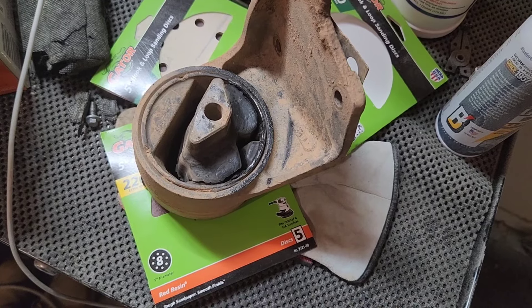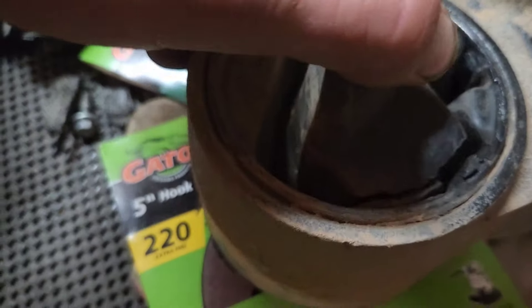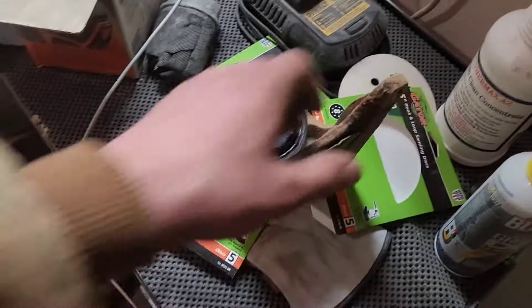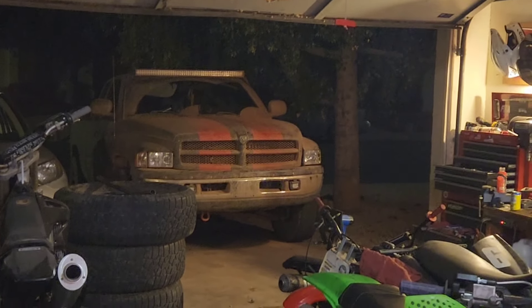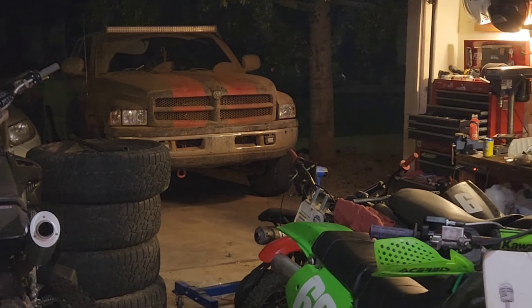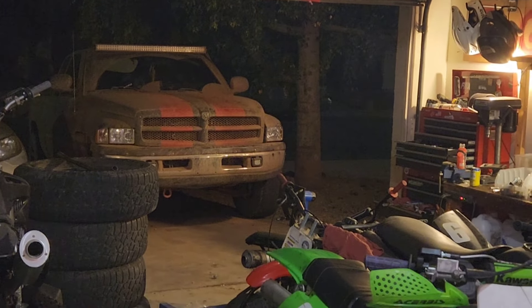Once I got everything positioned in, I went ahead and tightened everything down about as tight as I could get it. Both engine mounts were pretty done to say the least — both of them are cracked. The transmission mount, as y'all saw, was in two pieces. So the next step, I think I'm going to be putting in a Belltech transmission mount, because I went out wheeling this weekend and it was bottoming out a bit more — as you can see by how muddy she is. But that's how you do all of your mounts on a 1998 Dodge Ram. This applies to pretty much any of the other Dodge Ram 1500s and 2500s that had the 5.2 or 5.9 V8. Thank you for watching, see you next video.